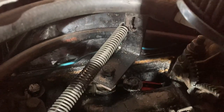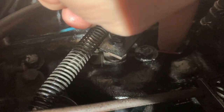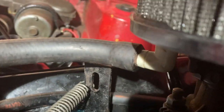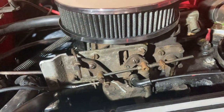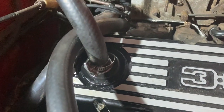You can see there's pretty much a puddle of oil down here where it's all just leaking out of this pipe. It's also leaking out the side of the air box and going into the carbs, so I'm burning oil. That might be the blue smoke coming out of the oil cap as well, because there's a lot of oil in there coming out of this tube.